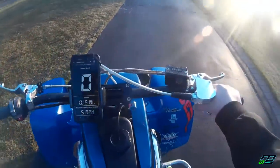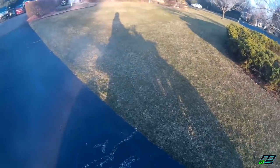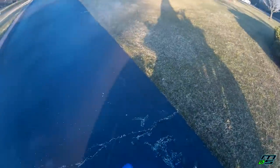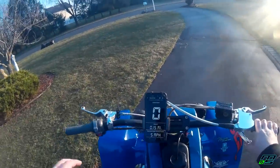is that it's not jetted yet. I just kind of threw jets in there. I was guessing we're going to be doing plug chops this weekend. It looks a little smoky, so I think it's a little bit rich yet. It's a little bit less than the last video.